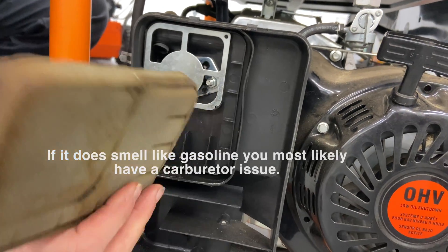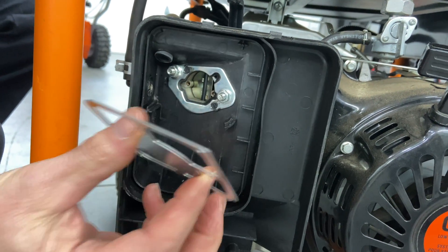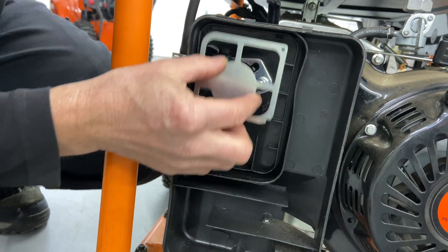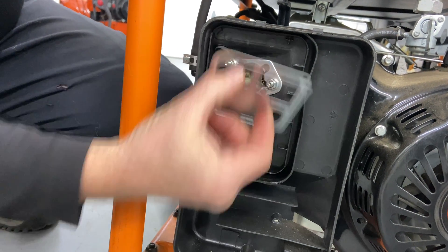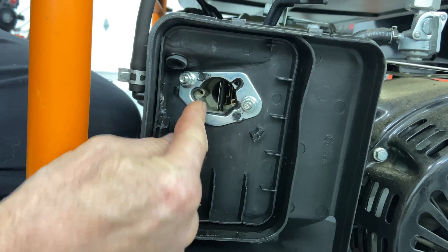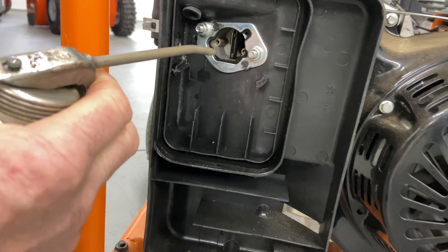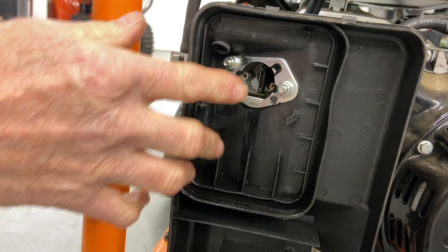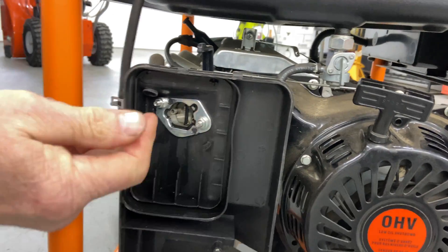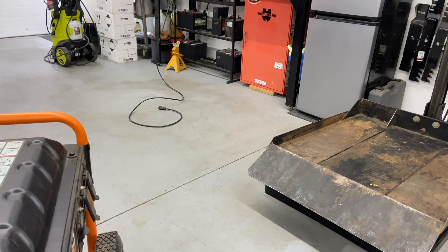What happens is the oil sinks to the bottom of the air filter. As long as it doesn't smell like gasoline, you're okay — and this does not. I'm taking this piece out, and you have to remember which way it goes; it has a little stud on top and a cutout to align it correctly. Now I'm opening up the choke so it's not closed, and I'm going to spray a little fuel right into the throat of the carburetor using a metal container with gasoline. If you're not comfortable doing this, have a professional do it. Then I'll put the choke back on and pull the cord — if it runs briefly and stops, we likely have a bad carburetor from old gas.